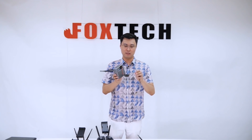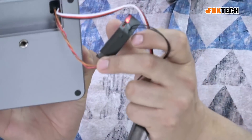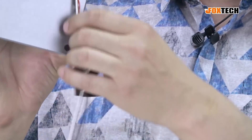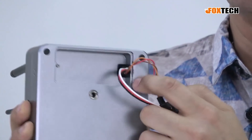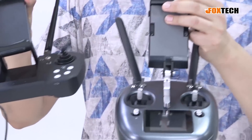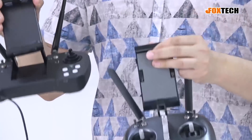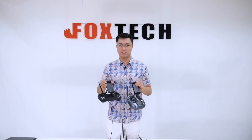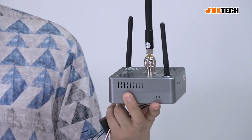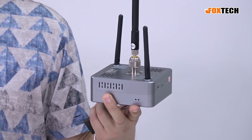You can see here we have two receivers. The D04 is also turned on and you can see the receivers are on, with power input directly from the D04. We have two S-BUS inputs, so we can use the S-BUS output from the two receivers directly. Then we can use two radios to control the drones — your UAVs — with a maximum of 32 control channels. The best thing is you can put everything outside and stay in the cozy room or cozy car and control the drones just like a professional.